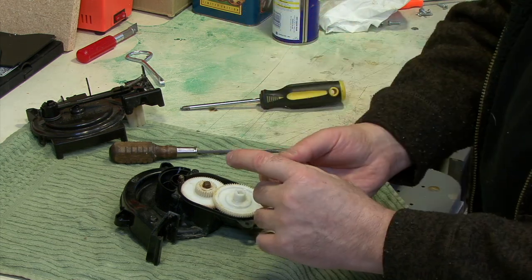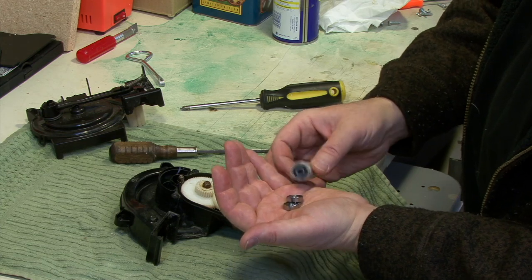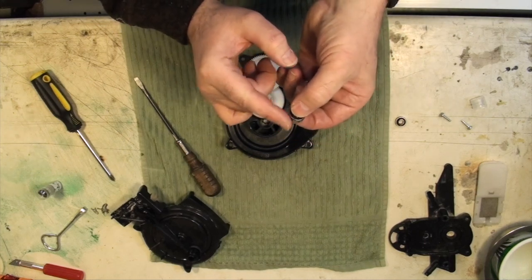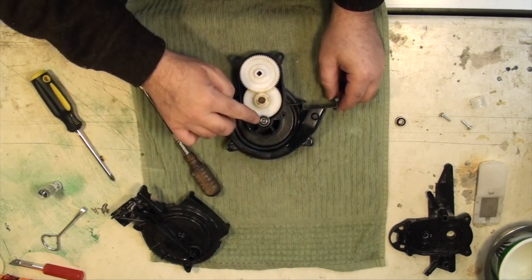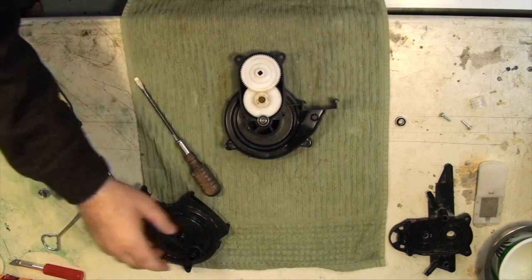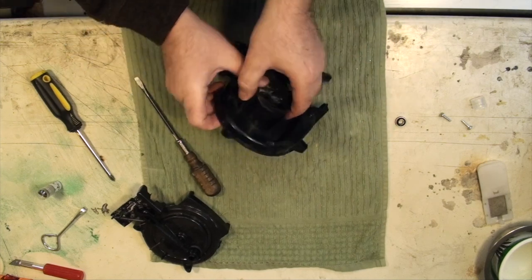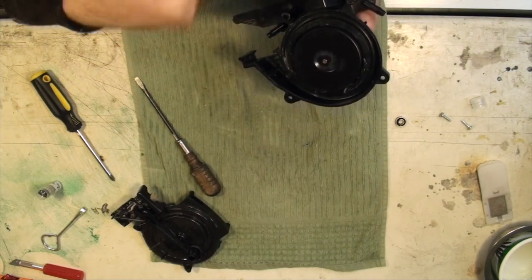Here's the 10-pack of replacement bearings — I'll put the specs in the description. It's about eight dollars for the whole 10-pack, and this probably won't be the last time I need to do this. Take one of the brand-new bearings, set it down on top, and press it on — it doesn't need to be a super tight press fit. Now it will engage with the bottom fitting when turned over. Check it: turns pretty decently — it's going to work.